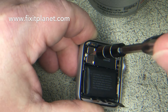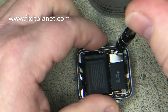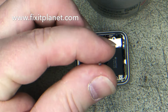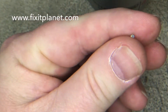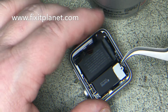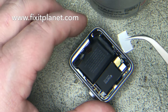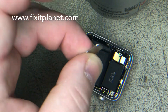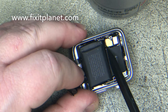This is very nice in comparison to the Series 1 watch, because on Series 1 it's just sort of clamped down over the top of the cables — not so easy to take off. You can see the tiny screw; be careful that it could potentially strip on you, and that might make your life miserable. The metal plate comes right off once you have the screw out — very nice! I like that — makes it much easier.